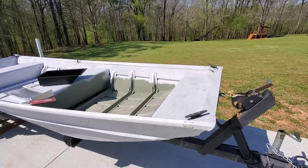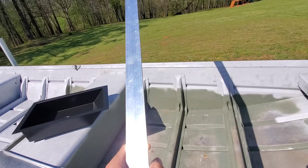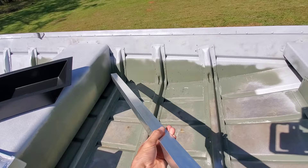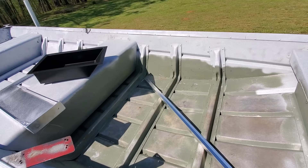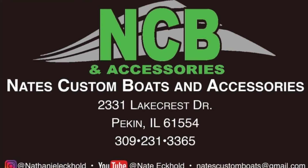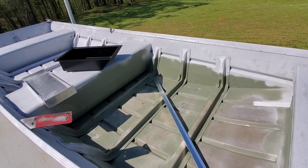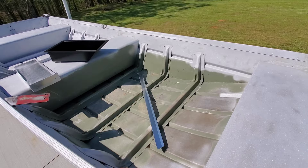Let's start with the front deck layout. What I'm going to be doing through all the framing in this boat is using 1/16th aluminum, inch and a half by inch and a half. It's all going to be riveted together with my Milwaukee rivet gun, and it's going to be a hybrid boat. The customer wanted to save some money, so we're going to do half-inch marine ply as the decking. I'm going to coat the tops in fiberglass resin and then wrap in carpet — carpeted decking with plywood hatches as opposed to aluminum hatches, just to save some money. All aluminum framing throughout, wood decking, hybrid setup. That gives the customer the option, if he keeps his boat long term, to pull the ply and drop back in hatches and do sheet aluminum because the aluminum frame will already be there.